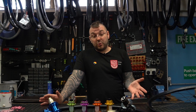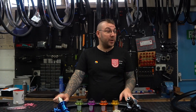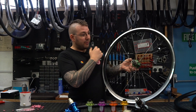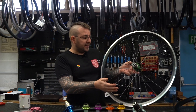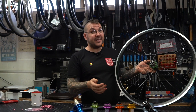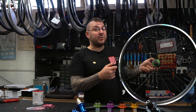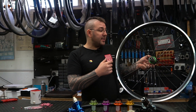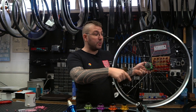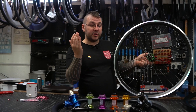Let me quickly talk you through each of the four different wheel options. Rim brake road: it's real simple, designed to meet the need that a lot of rim brake riders have for a quality pair of fast, lightweight wheels. You've got options for either 23 or 30mm deep rims depending on your preference, and if you want them for Sunday best or climbing they've got some super light hubs available too. All spoke counts can be changed, so you can have them stripped down and super speedy or ready for the hard knocks.